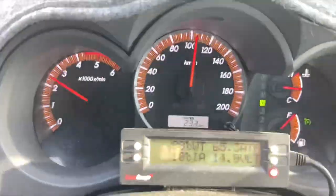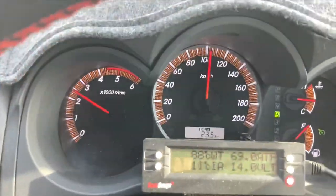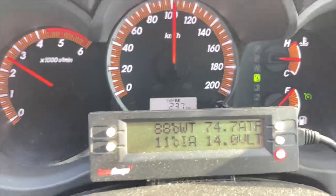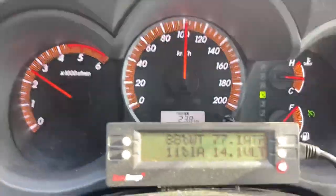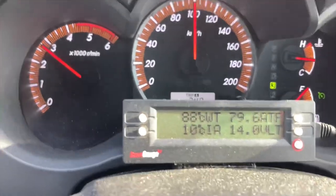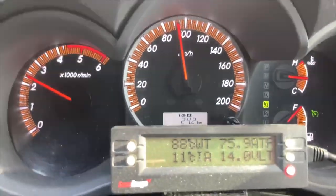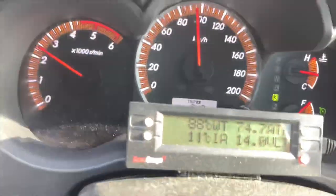There we are, just in time for it to unlock. That's fourth gear. It's a decent hill. Watch it make the heat — look at that ATF on the top. It's torque converter, watch how fast it pumps that heat. The problem is you can come to the next flat ground and not know it's slipping. Ideally, back it off till you get torque converter lock, then try and maintain speed. See how the temperature's dropping really quickly?